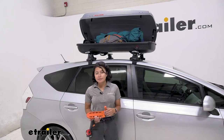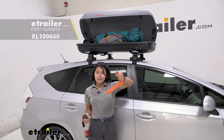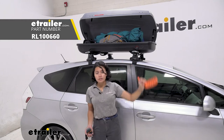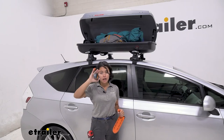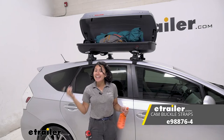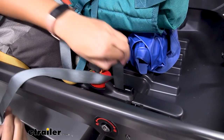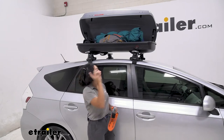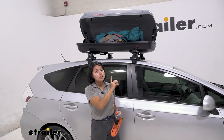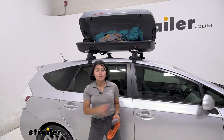While this box includes everything you need — including keys to lock it down — there are some extra tools I recommend. One is the Moki doorstep, which I used throughout this video whenever I have to work on a car roof. Also, straps are not included; you can pick up a pair of E-Trailer cam buckle straps that fit into where the clamps go to create a strap-down point so your cargo doesn't slide around. Finally, grab a tape measure to make sure your roof rack fits, since the crossbar spread can get tricky and this will not work on all cars.